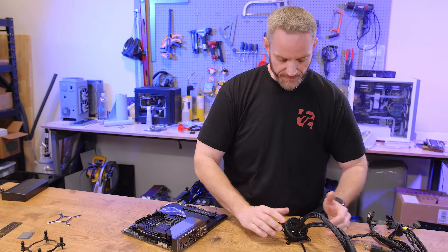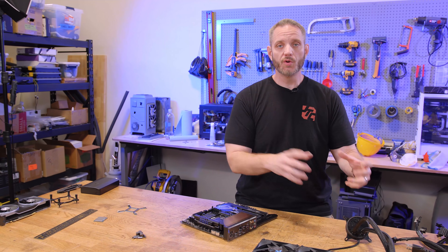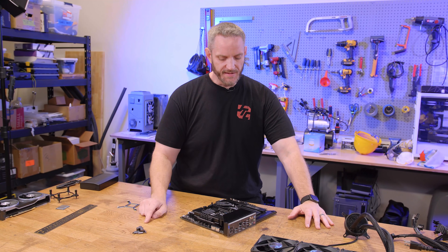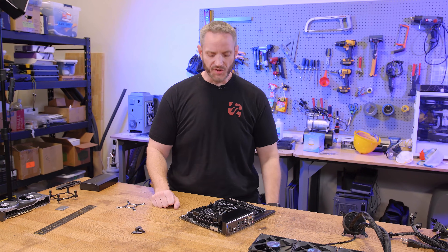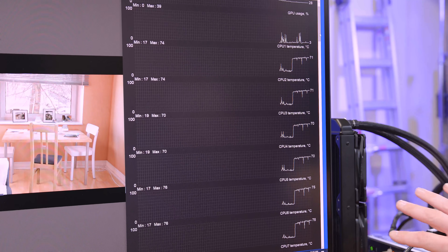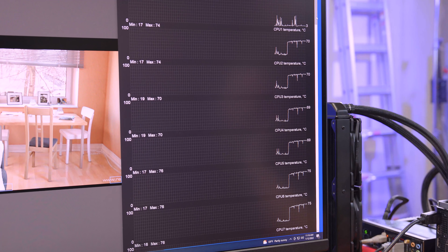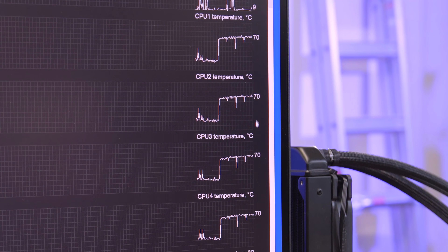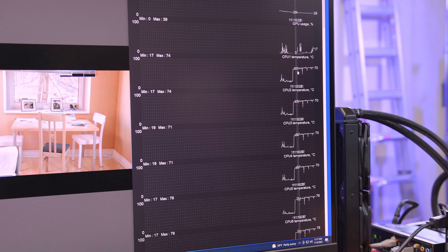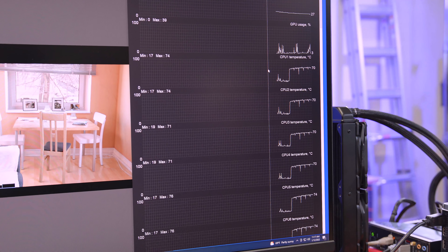We'll be using a 360 AIO from Fractal Design. We'll use the old system setup that I know people are doing — taking their old coolers and plopping them on 1700 and saying temperatures are bad. So let's test it with the old hardware, get our baselines, then test it with the spacer mod, and then test it with a lap mod. I just tested a Cinebench run — it's looping, set for 30 minutes. The temperatures are already looking good here. I mean, look — low 70s, 75, 67, 74, 73. You can see they are trending upward, so we need to let this go until it completely stabilizes to see where it settles.